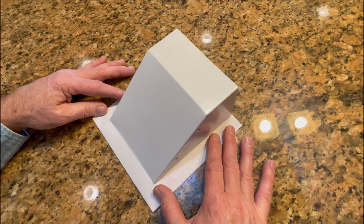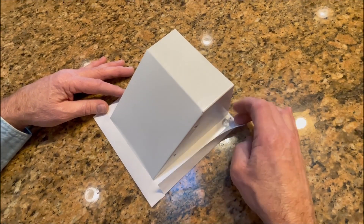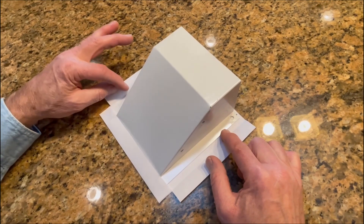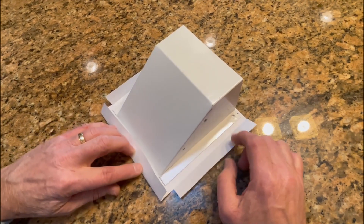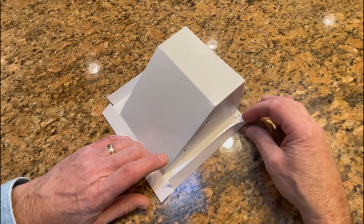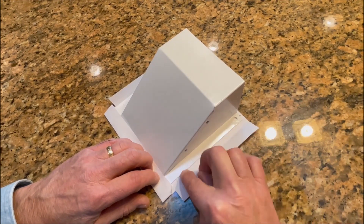I want to explain how the piece was made. Basically there's a metal piece that's bent over this edge of the vent hood, and there's a metal piece on the opposite side and one on the top. What we're going to do is take an angle grinder and grind down this edge so that this entire flap of steel will come off, leaving just this piece.